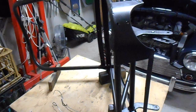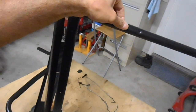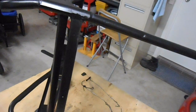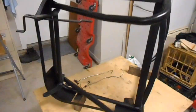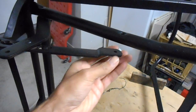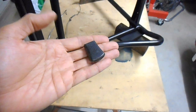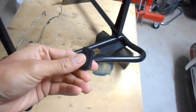So let's go and look at the frame. The frame of the seat has been sorted out and cleaned up. If you want a hint to get rid of the foam on here, I use paint stripper. You pull as much foam off as you can, then paint it with paint stripper, which sort of loosens up the glue and takes it all down. Wire brush it and then give it a couple of coats of paint. So the next thing I need to do is just the seat adjuster - get that spring and pin put back together. I've only got one of these pieces that go over here to adjust it, so that might be the next thing I need to try and 3D print.